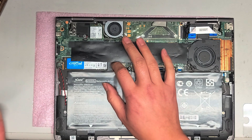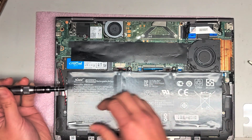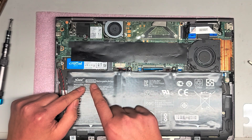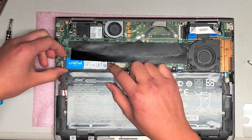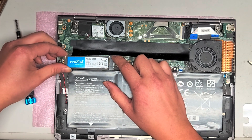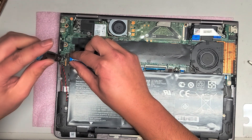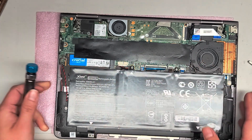You've got the M.2 PCIe NVMe SSD — we actually replaced this on this one. You need a PH0 or JIS0 screwdriver to remove it. There's one screw here. The battery model number, assuming it's a replacement, is SH03XL. Once you remove that screw, lift the SSD up slightly and wiggle and pull it back. To put it back, insert it at an angle, push it in, line it up with the screw hole, and put the screw back in. That's how you replace the M.2 SSD — you can upgrade to a larger or faster SSD if you want.